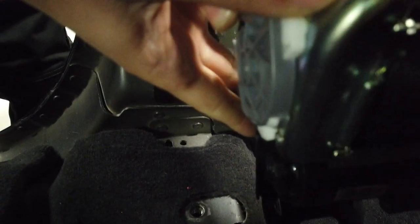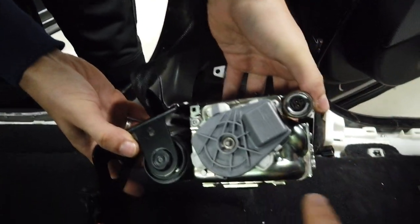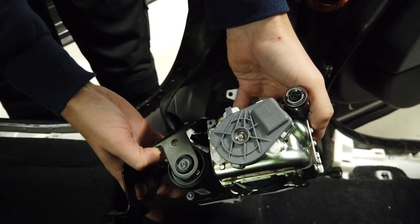It fires the ball bearings down this pipe here, and they come along here, then up here, and around the side. What it does is it spins this wheel which retracts your seat belt. That's your seat belt retractor pretensioner mechanism.